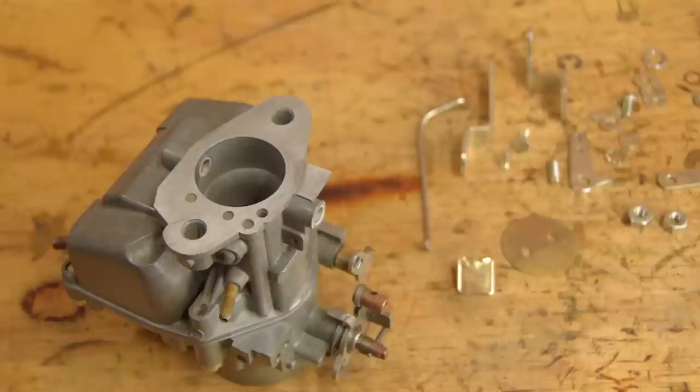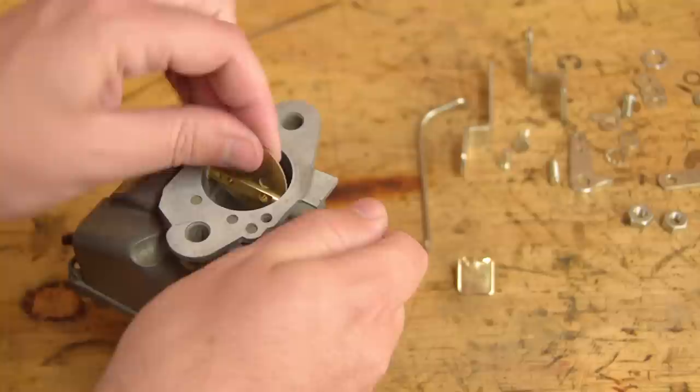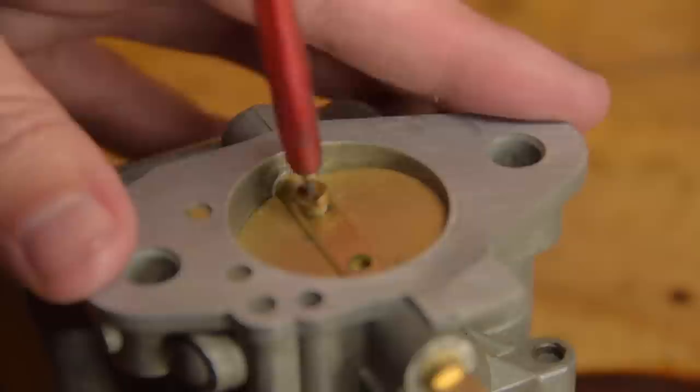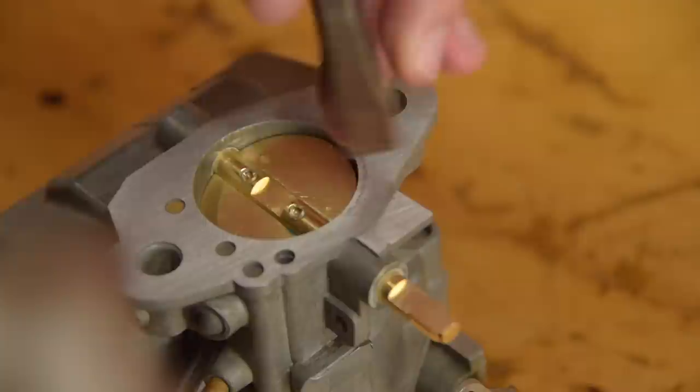This is the main throttle. I'm installing a new shaft into our nicely machined bushings. The little screws will be hanging upside down over our engine, so I drowned them in Loctite, and then peen over the ends of the screws. If you're careful when you remove these screws, you can get away with reusing them a few times. Next time I'll probably have to replace them.